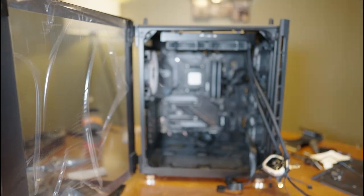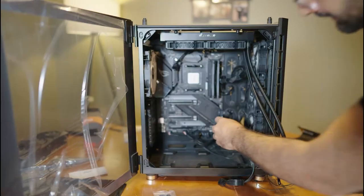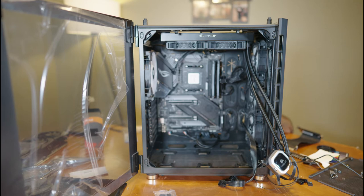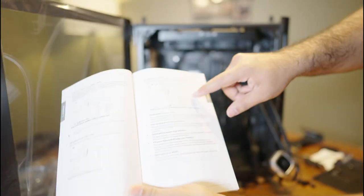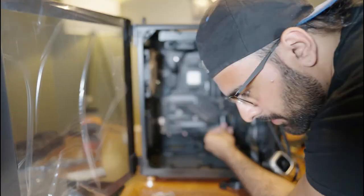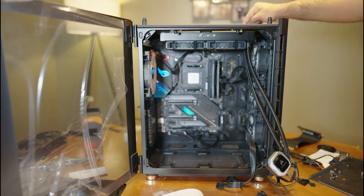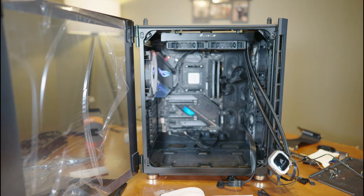The second-to-last thing for this motherboard installation is to install the PC case wires, including the power button wire — if you don't install that properly, you can't turn on your computer. I made a mistake here: my motherboard has three rows of pins, and I had used the top two instead of the bottom two like the manual suggests. Make sure you read the manual twice and install once to save yourself some hassle.